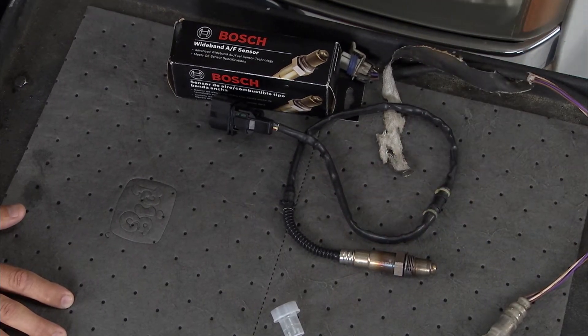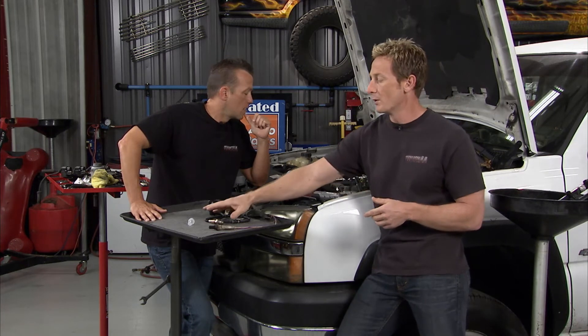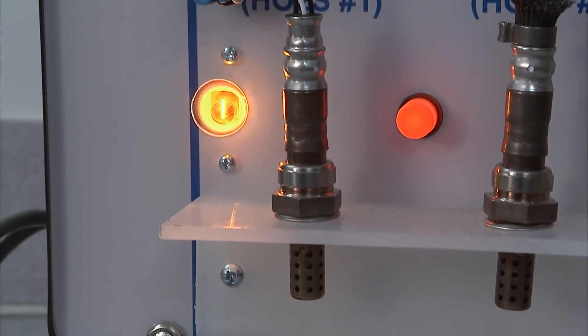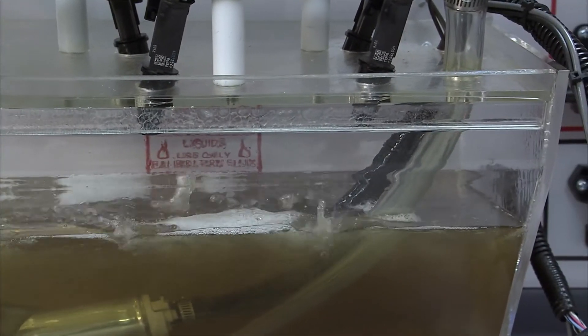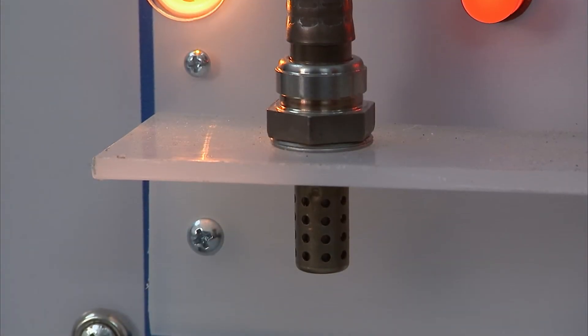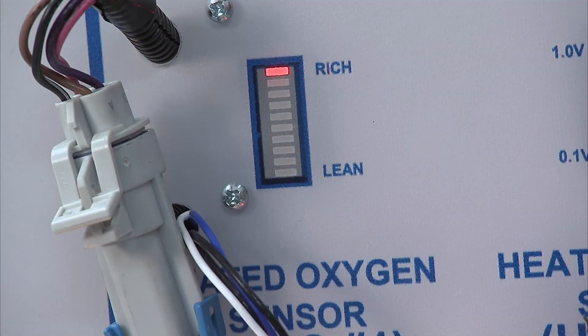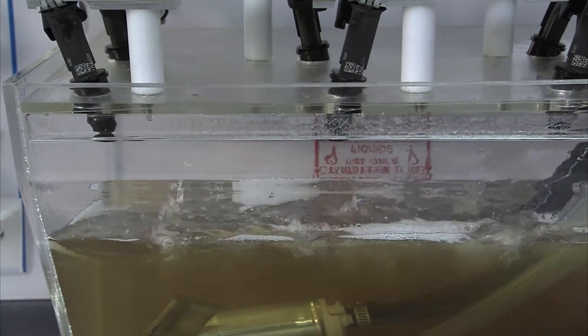As Matt said, in terms of being precise, an engine like this should run about 14.7 to 1. If your O2 sensor is bad, let's say it's telling you it's 11.7 to 1 — it's telling you to pull fuel away to lean it out, but it could be giving you bad information and you're going the wrong way. Also, if it's not reading at all, the engine goes into what they call open loop, which means it basically shuts down, gives no readings, and runs a rich tune-up they put in to keep the engine from burning up. What I think is going on here is this O2 sensor is not even reading, the engine is running rich, and we're getting a code — and none of that is good.